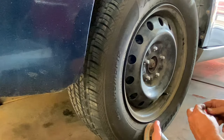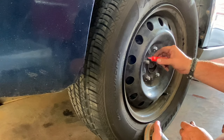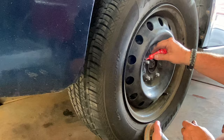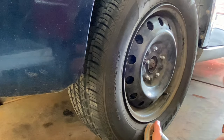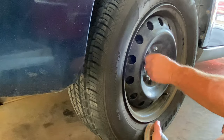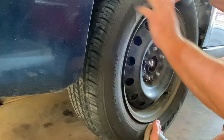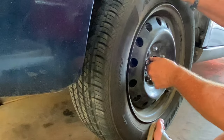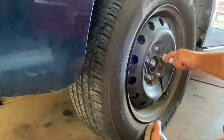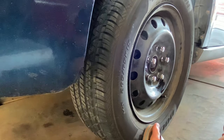Because of this issue I've had with several Hondas and Acuras, I'm going to go ahead and thread lock these lug nuts too. Always start them by hand, get them kind of in place, make sure you're seated well, and we'll get them on tight.